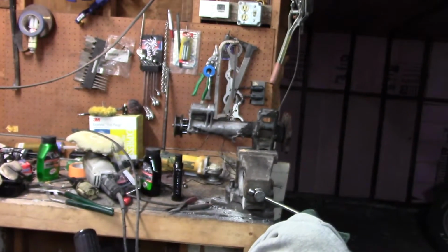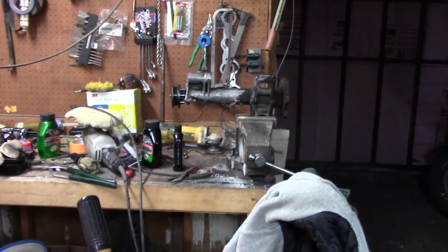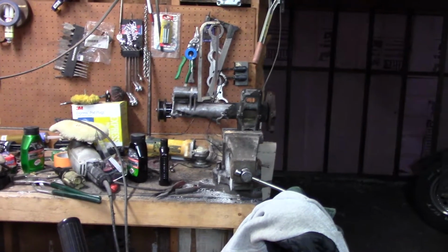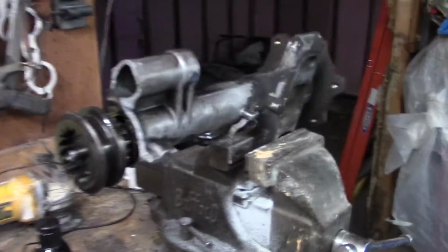It's actually a pretty cool deal. The problem is it's not strong. You don't want to put a 10-inch lift and 44-inch tires or whatever it is you're going to do, and then go out there and try to put it in low lock with a supercharged 6-liter and expect this front axle to hold together very long. You'll break it, because it's just aluminum, pot metal.